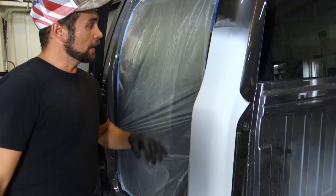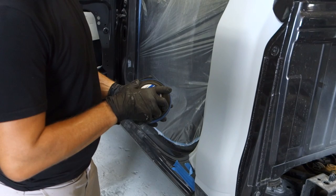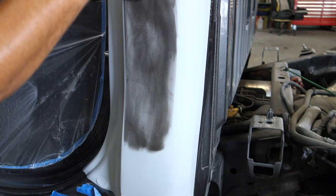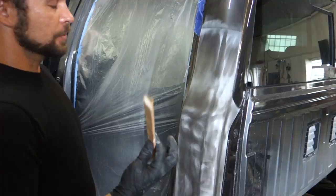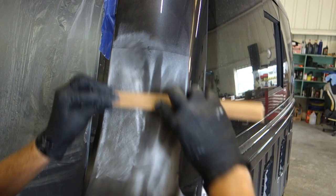We got our feather fill on the cab corner. The lines are still going to be a little bit wavy, but this stuff is basically like liquid bondo so we'll be able to still correct that line to make it perfect. We got a couple of high spots that I missed that I'll hopefully sand out. We'll let it dry and then we can start sanding. Our feather fill is all nice and dry. Since we're getting really close to getting that shape, I want it to be perfect, so we'll use some guide coat on here — this will show me exactly where everything is. I got a 400 grit on a paint stick so I'm just going to keep going over it until everything is nice and even.